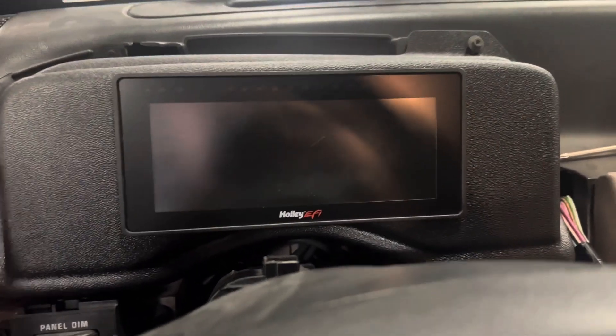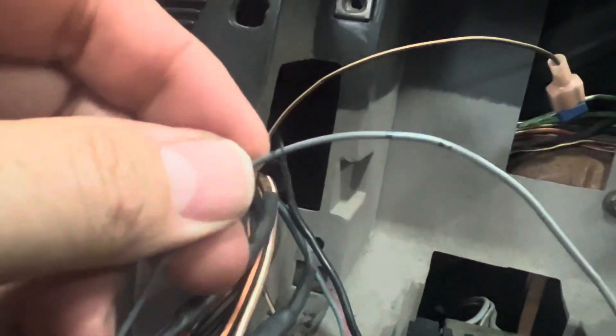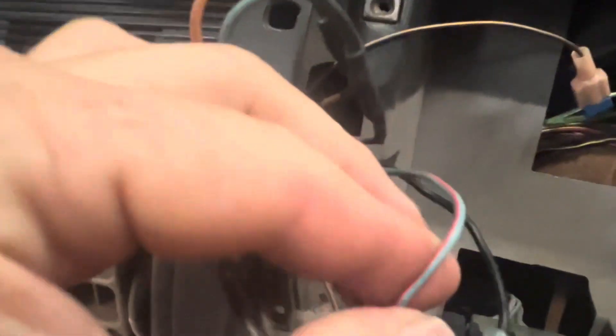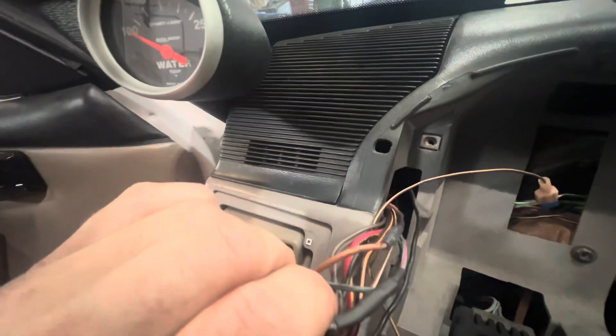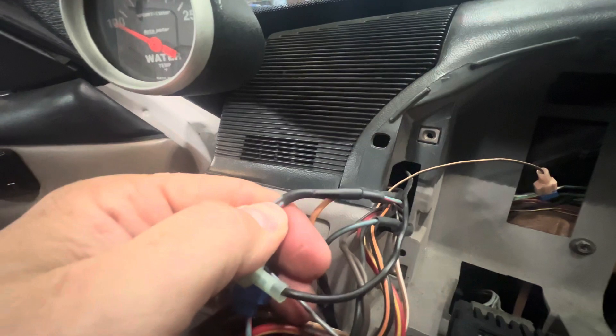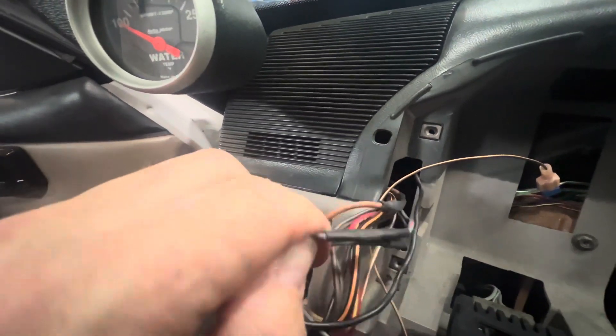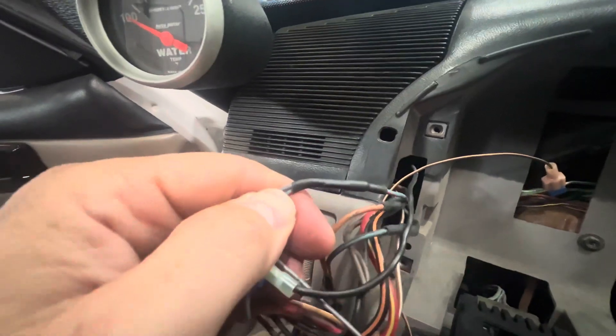For the first part I'm going to pull the bolts out of the dash and then unplug the clip in the back. I'm going to take this gray wire — this is for the dash lights — and it's going to tie into this blue with the red wire here. Used a reducing non-insulated butt connector and some good adhesive-lined heat shrink. That's the first connection.